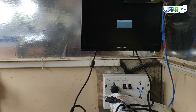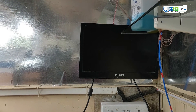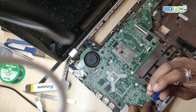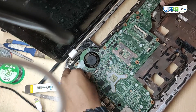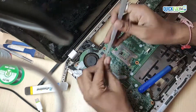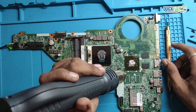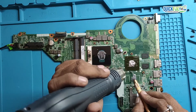Pressing the power button, the ampere reading is normal. That means the screen or graphic-related fault is there. So let's disassemble the laptop. I suspect the graphic chip needs a reflow, because due to overheating, sometimes solder joints underneath the chip get dry. Here I am removing the glue which holds the chip in place.